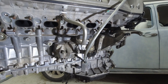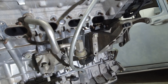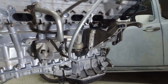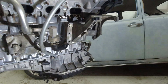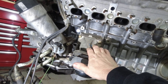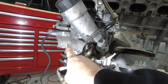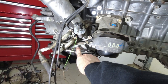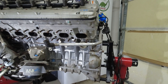Starting on this side, we're going to take off the motor mount arm, the breather hose, the dipstick tube, and then this bracket right here. This breather hose actually goes all the way around to the other side of the engine. Over here we're going to take off this motor mount and motor mount arm, the oil filter housing slash AC mounting bracket, and the breather tube from the other side off the back of the engine.